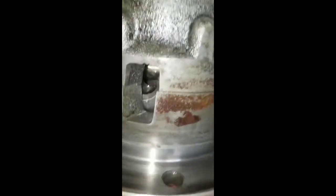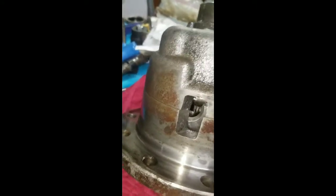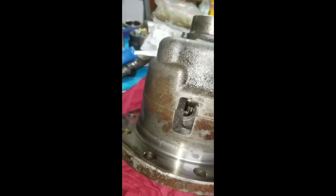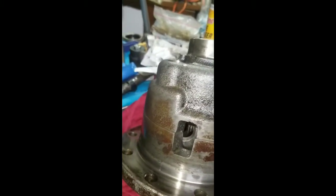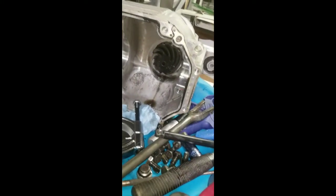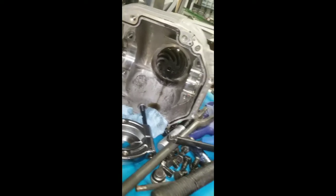Here's the strange thing. When I got the axles out, I really thought the axle CV joint was broken at first and thought that was all that was wrong. That was on the passenger side. I went to the driver side, and when I got that axle out and looked through the axle housing, I could tell the spider gears were broken because it was not straight — things were all out of whack.